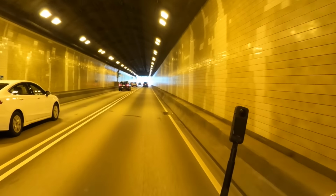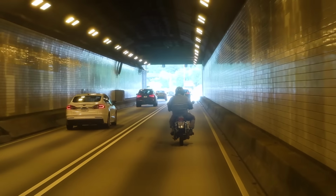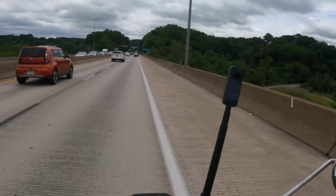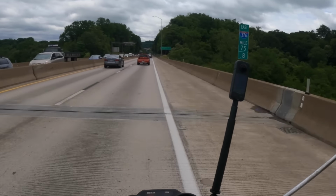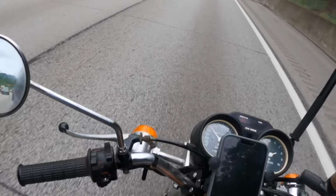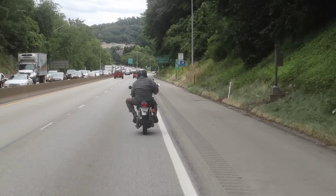The way this idle's hanging, it's almost like cruise control. I haven't been on the throttle for a while and I'm still going 50. So the idle's hanging because it's super lean, and that's just gonna cause a hanging idle and a high idle. Oh, this is sucking vacuum. I bet if I close this hose off down here, I think it'll run better. Talking about that hose from earlier? Yeah.